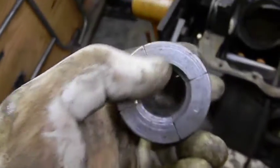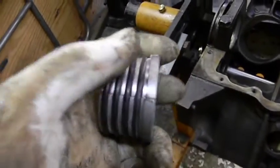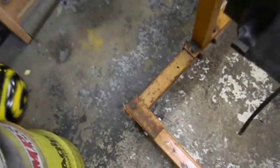Basically what you have is the bearing on the tool around these O-rings. And as you can see, this is a split, and the device I have in between is actually a wedge and widens this. Now, like I said, you want a decently snug fit on this when we're driving these bearings in, and it has to sit on this shoulder perfectly, and there's a collet that sits on this inner lip perfectly. And this shaft will be coned to hold it. You take your time, and you got to put the bearings in right. You have to line up the oil galley holes and all that stuff.